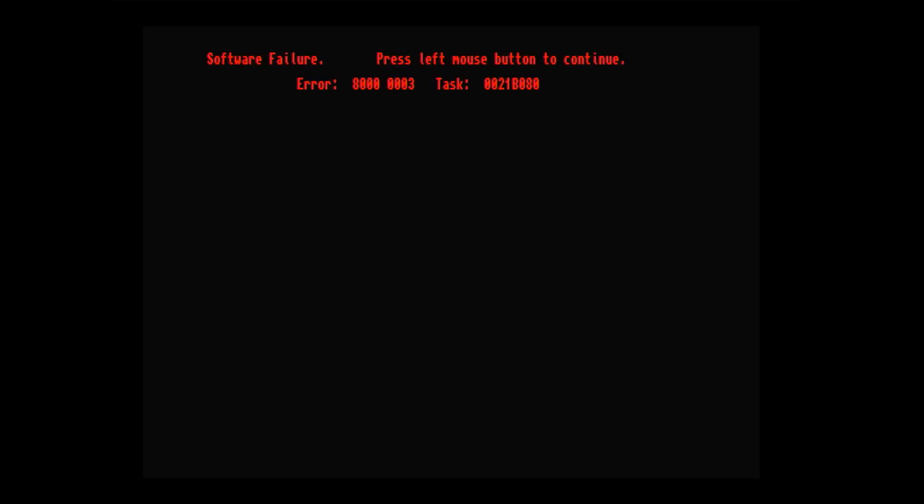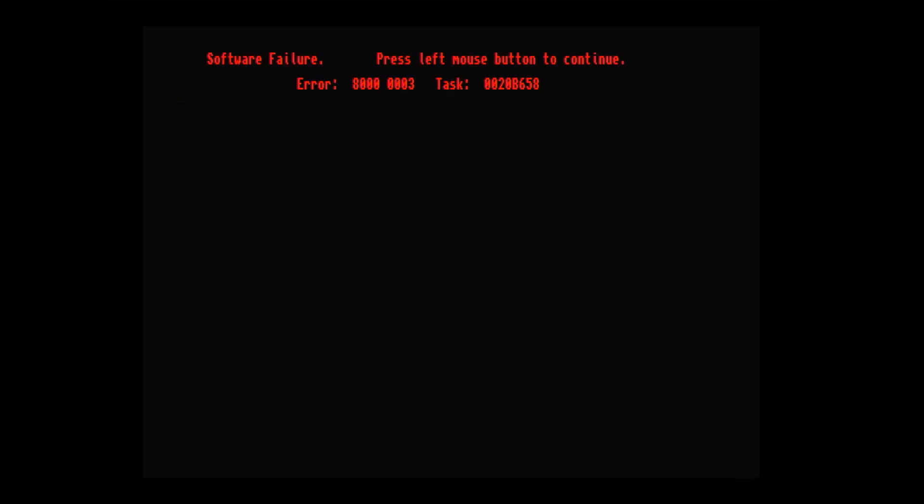I'm booting from the A590 setup disc here and I've sped this up a little, but well, I guess it's not locking up anymore. That being said it's still not a good result. I'll try this again with the autoboot ROM dip switch enabled. Hmm, same result. So there must be a different or another fault. This board is starting to be a bit like whack-a-mole. I find it hard to believe that this new chip is faulty, but as it won't boot with either chip it's either not as compatible as I was led to believe or something else is wrong on the board.